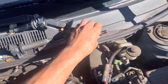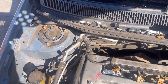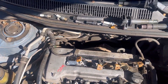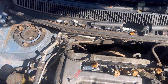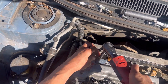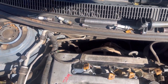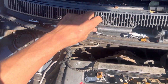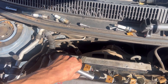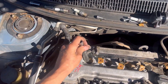The plugs wouldn't cause this type of misfire. Next thing I'm going to do is put a compression gauge on it and turn it over to see what's going on. That's how you properly do a compression test — you take all the plugs out so the engine can spin over freely. That's the idea behind it.